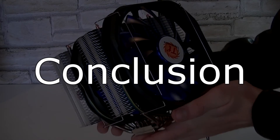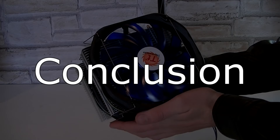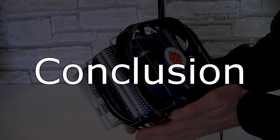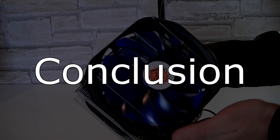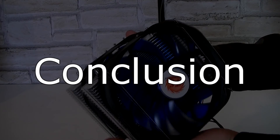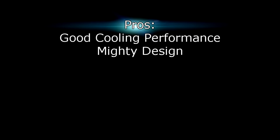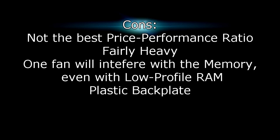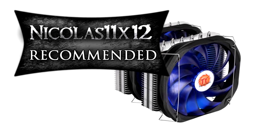The Thermaltake Frio Extreme CPU cooler is a pretty good choice but definitely not the best one. The cooling performance is good — I have nothing to complain about there — but it's not really worth it for the price. The weight is fairly high and could eventually bend the motherboard over long-term usage. Unfortunately it will interfere with basically every memory kit unless you raise the fan or mount it on the other side. Pros are good cooling performance and the mighty design. Cons include poor price-to-performance ratio, heavy weight, memory interference even with low profile RAM, and a plastic backplate rather than metal. That's why I give this cooler a 6 out of 10, but still recommend it for its cooling performance. Thanks for watching and don't forget to subscribe!